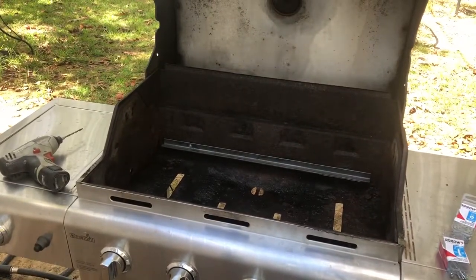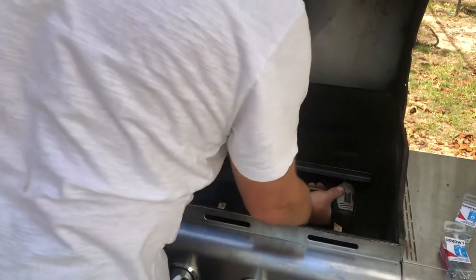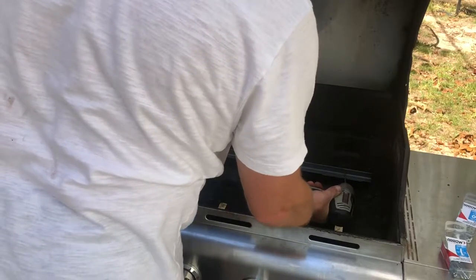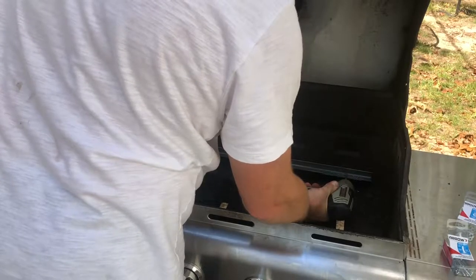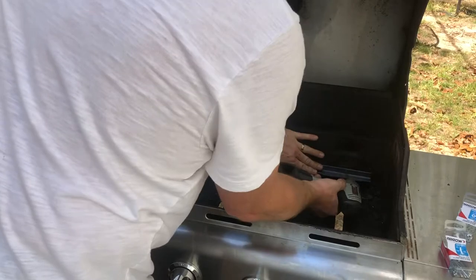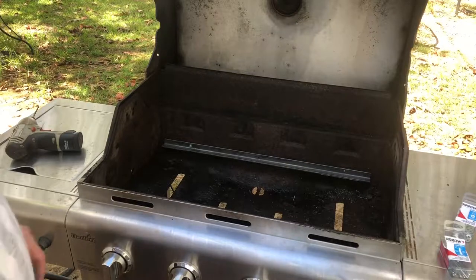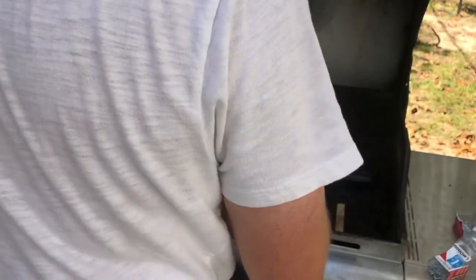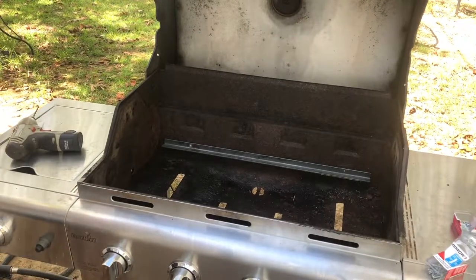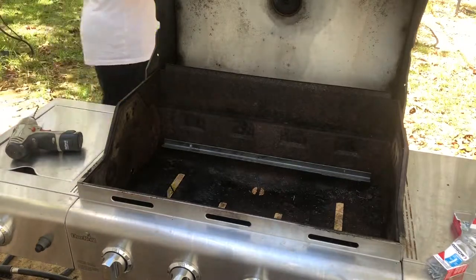Drill more holes and put more rivets in. So you do until it does get held tight. Now I can see that drill hole on the other side. I feel confident I can hit it like this. Yep, see, hit it perfect. Just because I can see down through that crack and I can get to it. Now this time, I'm gonna put one of these washers on each side. And that should make a huge difference for me. I can't believe that that metal pushed right on through. How crazy.